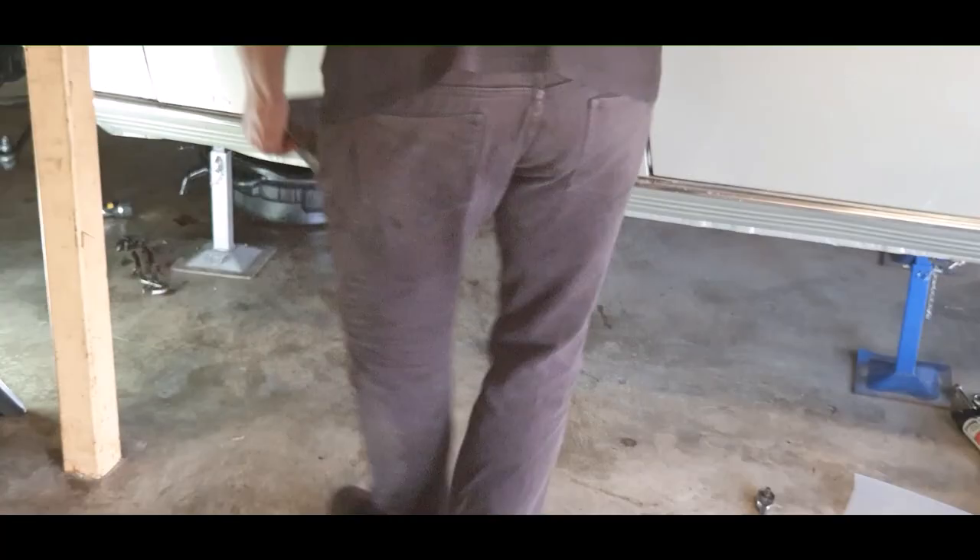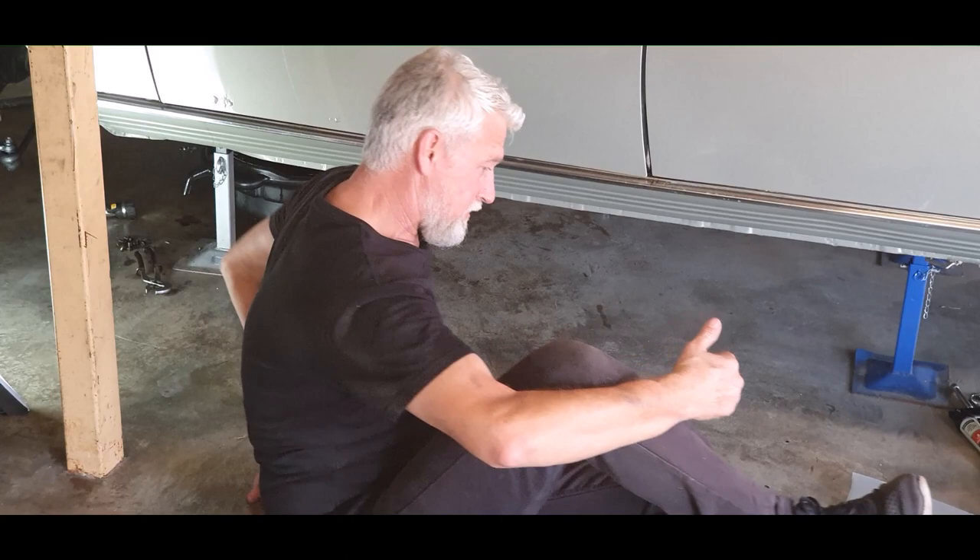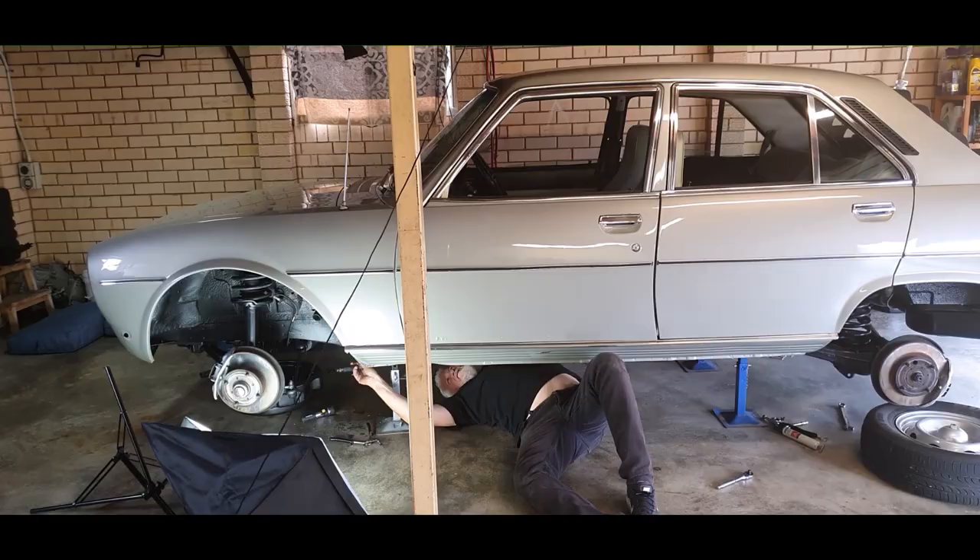With the new gasket on, head over to the car and reinstall it. Make sure when you bend over your ass crack doesn't show — just readjust those pants. Using a torque wrench, lightly nip those bolts up because with a cork gasket they need very little tension.